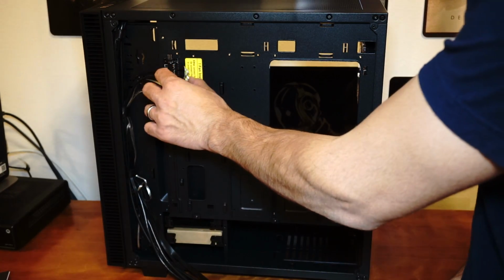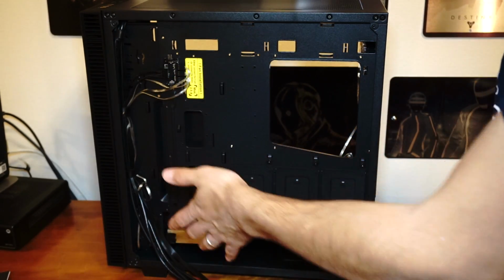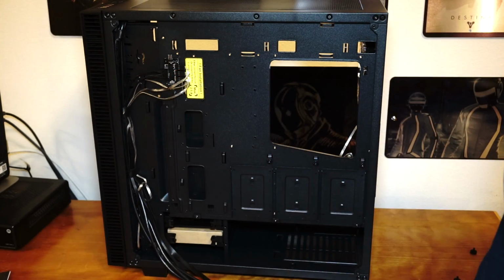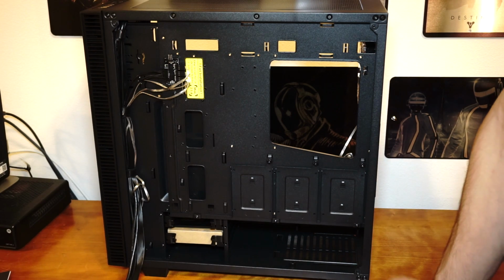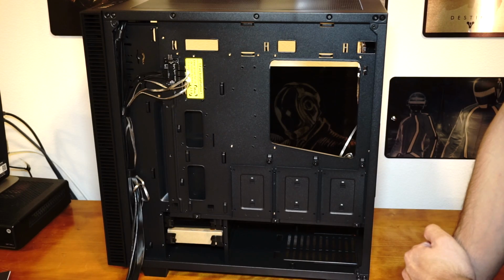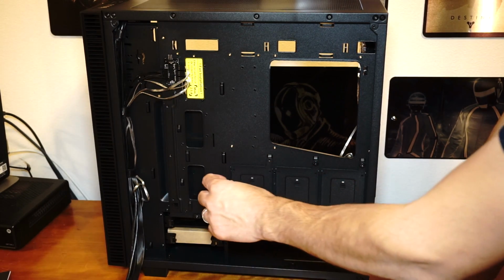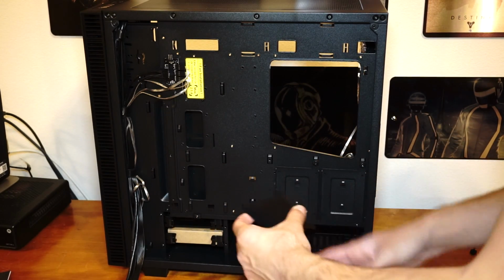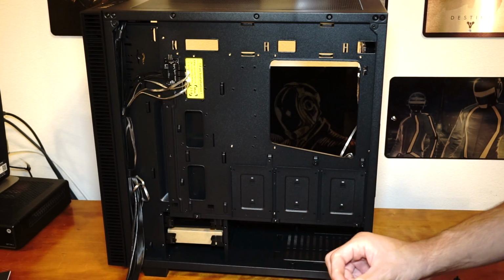So what's kind of nice, it's very easy to service because of this panel, the way it's designed. If you upgraded your fans, you can utilize the factory cooler, and it's nothing proprietary. So that's kind of important to note. Now, one of my favorite things about this is the triple 2.5-inch drive panels that are upgrade slots. So you have these little thumb screws you can remove. Again, all done by hand, super easy. Slide that up, mount your solid state drive, slide it back down, put the thumb screw in, run your SATA cables underneath, and you're in business.